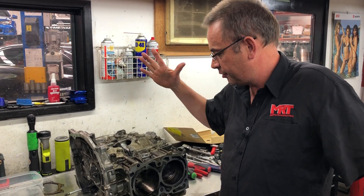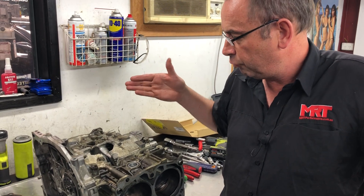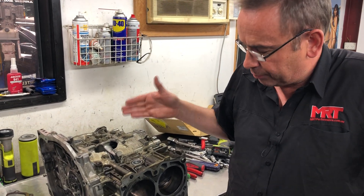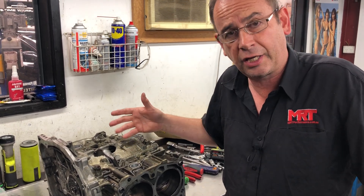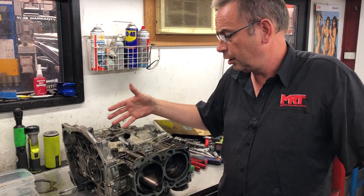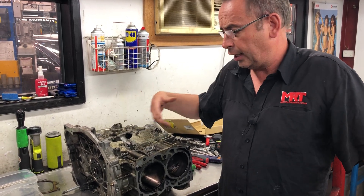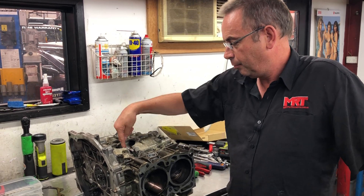What I've got beside me here is the EJ 2.5, out of an MY10 STI. It originally had an aftermarket set of factory forged pistons and rods, which is a common modification. The owner of the car sold it, the new owner bought it, did a level of other mechanical modifications, and then as you can see, it's punched a hole in the block.